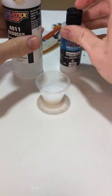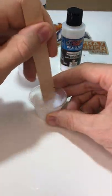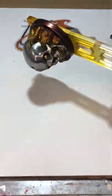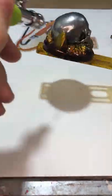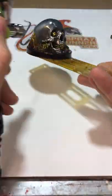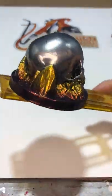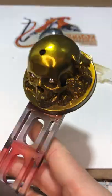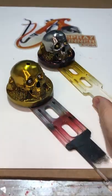Once you're happy with the finished paint job, this is the next most important part. You must top coat this with a UVLS gloss clear to not lose its shine. If you move straight to 2K, it will diminish the chrome shine considerably. The 4053 high gloss was my natural choice for this next step. Using the TG3 with the fan cap, applying 1 to 2 coats, and letting it cure for another day.